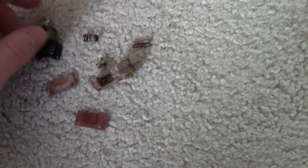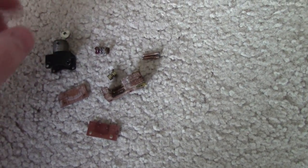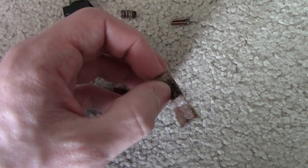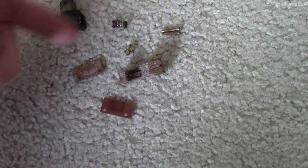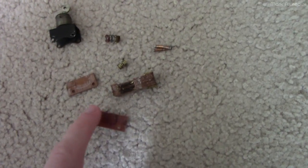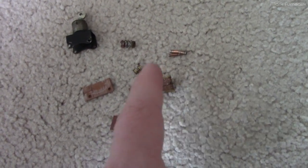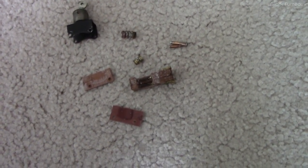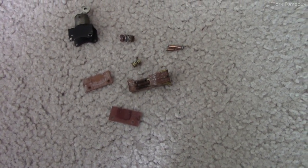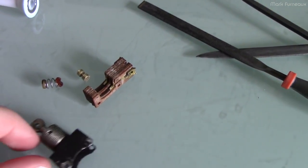I think this is just a case of contact wear and oxidation. I'm going to try and clean this - it's actually the first thing I want to do, because I want to get rid of the hot-wiring and get those wires tucked back inside so they stop moving around every time I tip the unit on its side. I'm going to try to clean the contacts and put the switch back together, find something to hold the casing together, and if I can get the switch working that would be pretty awesome.